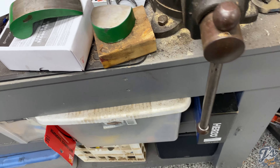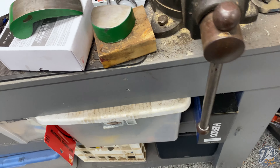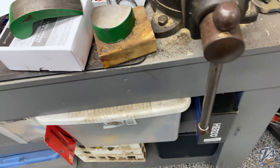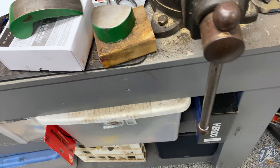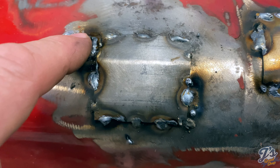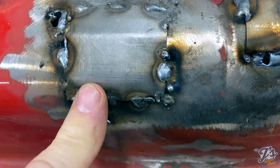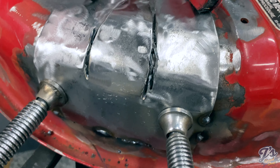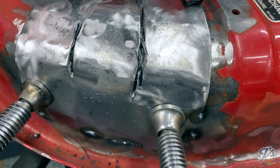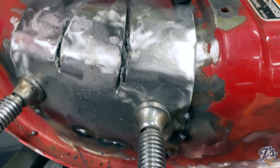We've started tacking - I've got this piece tacked in a couple of spots. It's ugly but it's holding. That gives us this edge from the factory edge, and we'll put in a piece here and then cut out the rest of this rust. These two are kind of ugly - I blew through in a couple of spots, which is my fear with this thin deck. I'm going to have to either put a little patch there or fill it with weld. Then I kind of started to tack this one up - I plan to back-cut this one, weld the piece in and get rid of all the rust. Just adjusted the clamps to make sure I've got a pretty close connection.